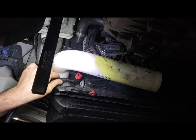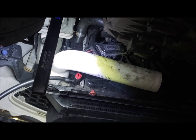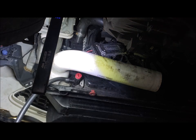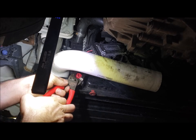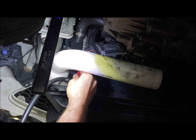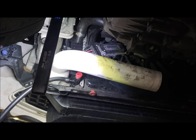Pop it over the end and put the other end into a clean container. Then just grab the tap and untwist it — this one's a bit stiff so I'm going to use some grips just to crack it. Pretty much all the way, and now coolant's coming out of the hose. Just going to leave that 5-10 minutes.